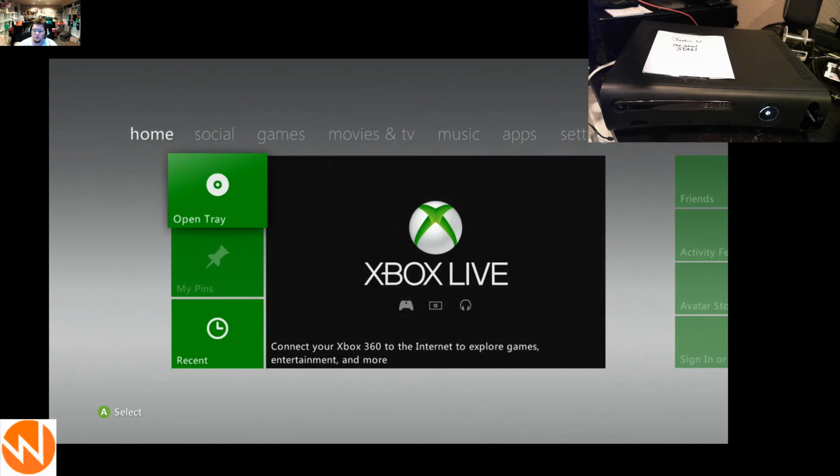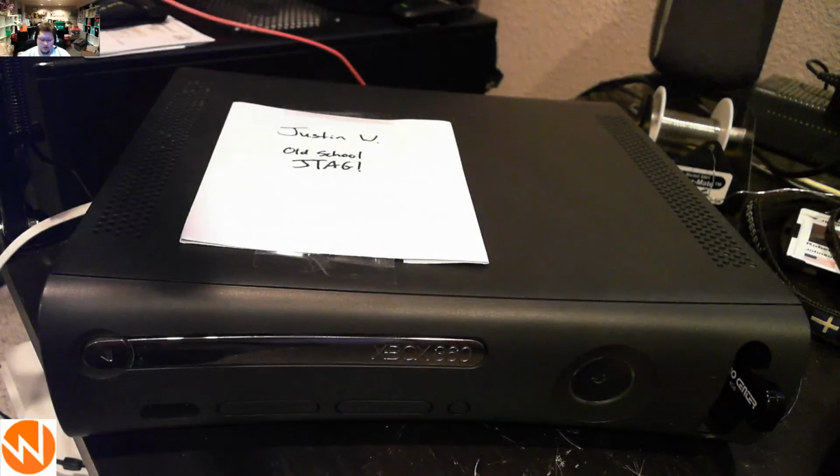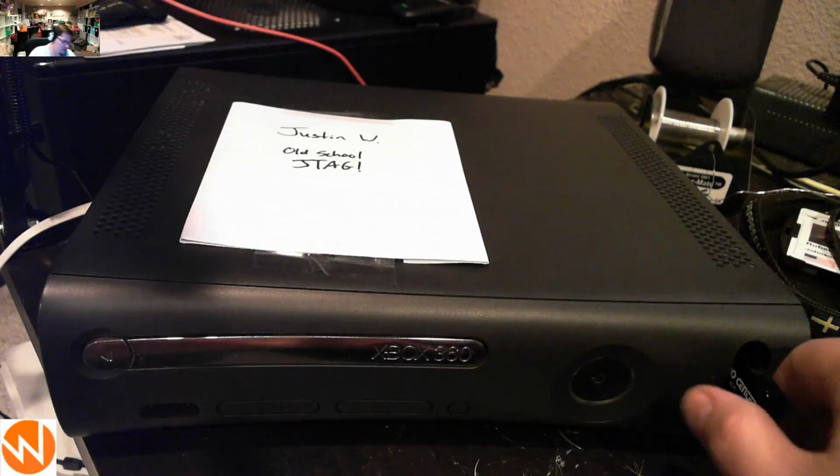I would caution you that you may want to crank up the fan speed on this guy a little bit. Zephyrs are fairly RROD prone, red ring prone, so definitely consider using something like Freestyle Dash settings or whatever to crank up the fan speeds.